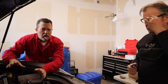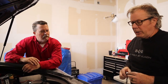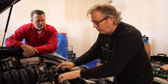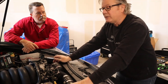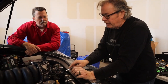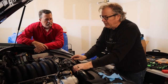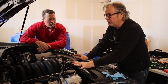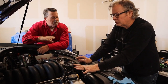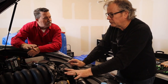Now we've got our side covers off and access to these bolts. Porsche calls this piece the air charger - it's the plenum that combines cold intake from either side of the motor and runs it up through the throttle body. We're going to take this part off, then take off the throttle body and all the associated wiring around the throttle body. Under normal circumstances, removing this would let you check whether your pipes were replaced with the metal ones once this front section is off.